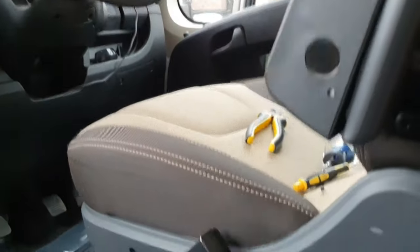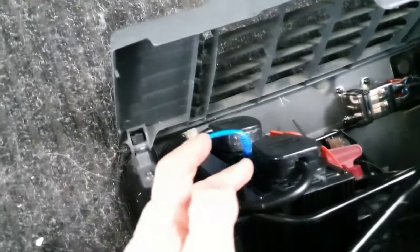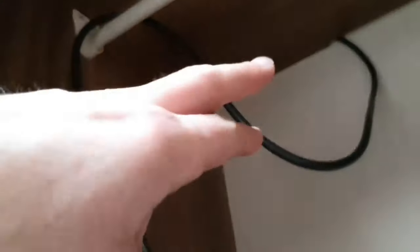This is the driver's seat here. I've connected up the 2000 watt inverter — when it's turned on it has a normal mains connector, 220 volts, which comes out and goes underneath my feet and through the cupboard. I ran the cable up here, and if I open this cupboard, I run it on the inside — tidied up along the inside of the cupboard so you can't really see it. It runs up to the top, and I managed to get it inside this panel here by just pulling the panel out a bit. I couldn't get the screw because it's right next to the ceiling with no room for a screwdriver, but I managed to get it through.